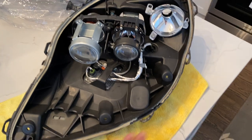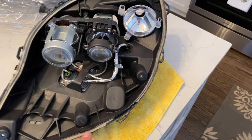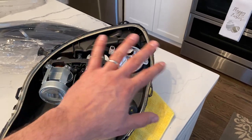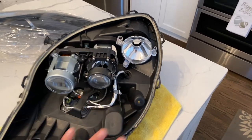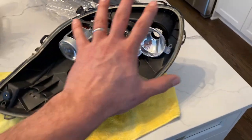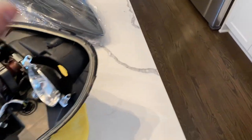You want to get as much of that old sealant out as possible because you want that new clear lens to sit in perfectly — nice and tight — not only for the seal but also for the contour of the headlight. Take your time. Heat gun is your friend — you can use a hairdryer, but a heat gun gets you there faster. Just be careful not to distort the headlight. Work on it until the epoxy is pliable, then peel it off. Once the groove is clean, blow everything out, clean your headlight and projectors, and get the inner main housing prepped.